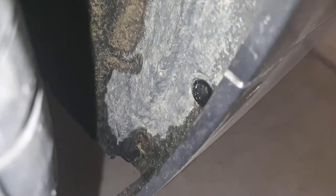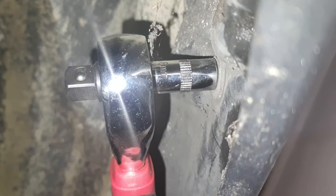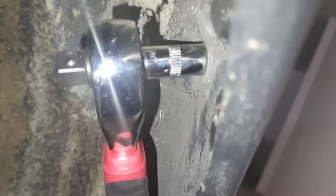To give you a clearer picture: there are three 8mm bolts — the bottom one I've already taken out, there's the middle one, and there's the ratchet on the top one. So those are the ones to remove. Remove those from each side, and then inside the boot...